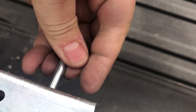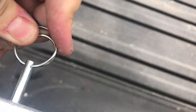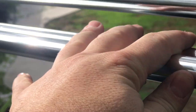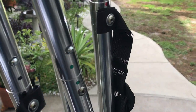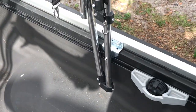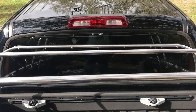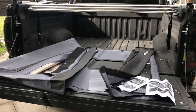Roll the little circular safety pieces out of the pins — they look like a keyring. Jump into the bed and slide the assembled piece onto the pins. The red dot faces the front of the truck — that's the biggest thing to take away. Drop them in there and the frame should fan out. Be careful it doesn't hit your back window.